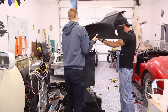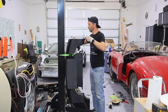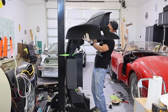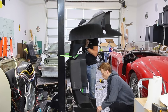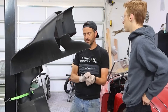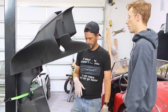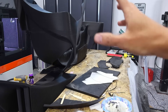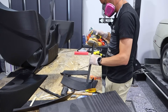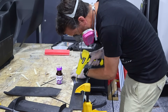We tried the Gloop on this one — it was just really challenging because we can't really clamp, we have to hold it in place, and we just weren't still enough. So we're going to try some JB Weld. The thing that's nice about it is it's got some stickiness — the other stuff had no stickiness. Just the fact that it's able to kind of stick that way means if you have any little movements it's not going everywhere. We're starting to make some progress — we've got a large portion of the bumper done. Some of these other pieces I'm struggling to put together because I can't clamp them. So I went and bought a plastic welder, and that's going to help aid with the bonding process.